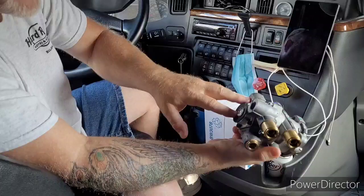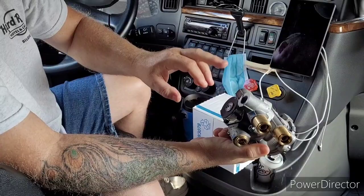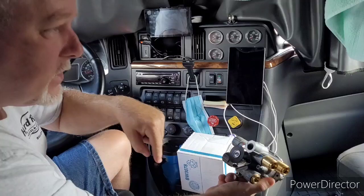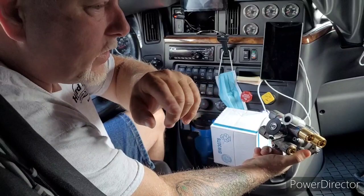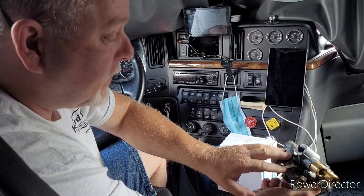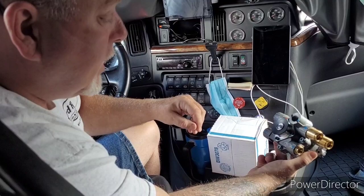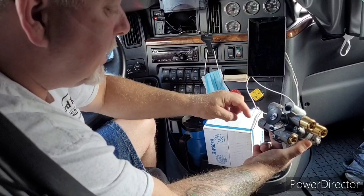What this is: it bolts to the firewall — this is what your service brake pedal pushes on. When you push that pedal it activates a plunger and allows air to flow through this valve to what they call signal lines. What those signal lines do is send air to a brake relay, and you have three of them on a vehicle this size with three axles — one for the front brakes, one for the front drive axle, one for the rear drive axle. You have delivery lines that come out of here, so when you push the pedal, air comes through a supply line, through this valve, through the delivery line, and runs to the air brake relays.